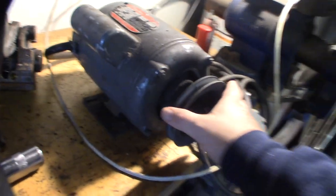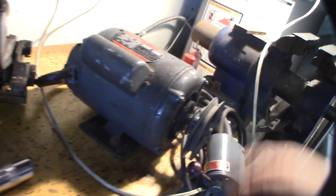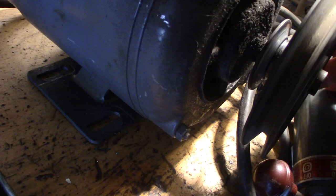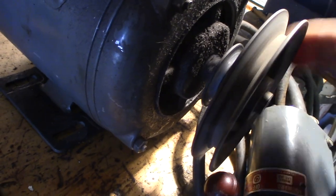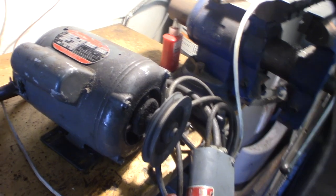What I want to do is look at the start capacitor, check that out with my ESR meter, maybe get a new one just because these electrolytic capacitors don't last forever. Plus I hear this noise. I feel like it only makes that noise because I plugged it in — you can actually test it now. The motor actually works; I can actually go back and forth with it.